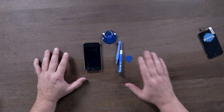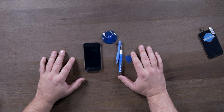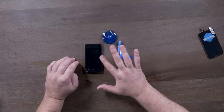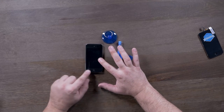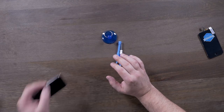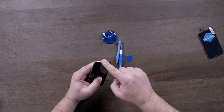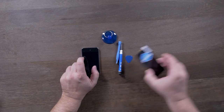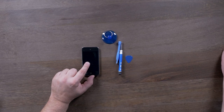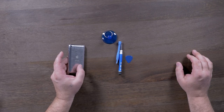One of the first things we always do with our repairs is verify that everything on the device functions prior to opening it up. On the iPod Touch 4th generation, one thing we really want to make sure is that your frame — the metal frame — is in relatively good condition. If you have any dents, dings, or wrinkles along the top edge, the new display assembly is not going to sit inside the frame. You may want to consider mailing it in and having us repair it as well as replace your frame.